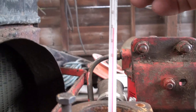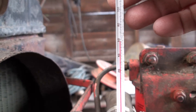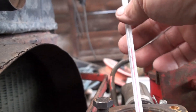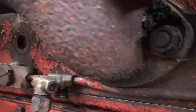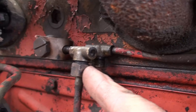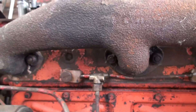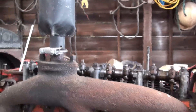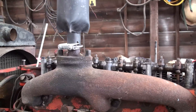It's reading 60 degrees Fahrenheit or 15 centigrade for those of you that aren't imperial, and we'll be watching the temperature as the engine heats up. Down here I've put a little old Nuffield T-junction filled with solder, screwed into the top of the oil feed pipe to the rockers — that way when the engine's running I haven't got oil splashing everywhere. But I have got an oil can and I've been along the rockers giving them all a squirt of oil so things aren't dry, to keep everything lubricated during the 15 to 20 minutes that I'm re-torquing the head.